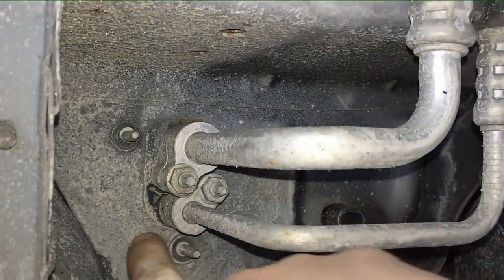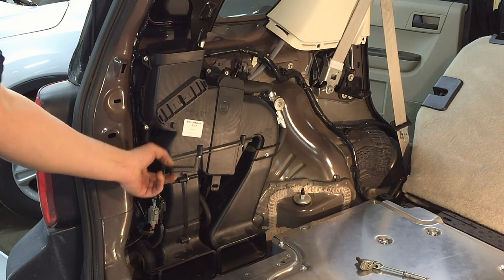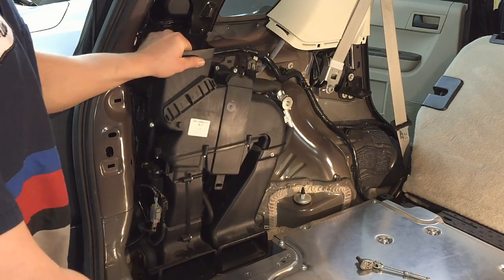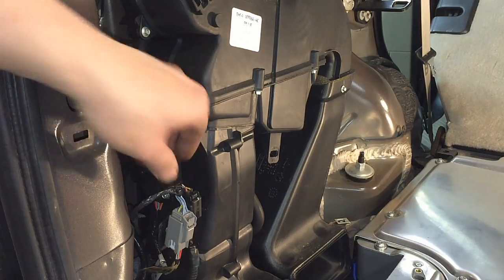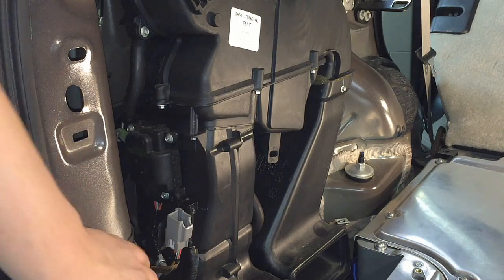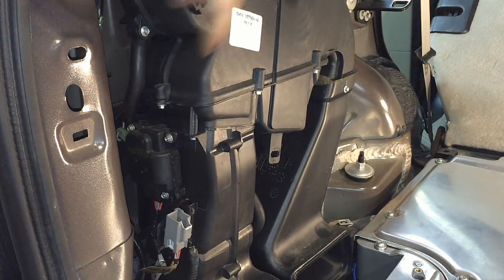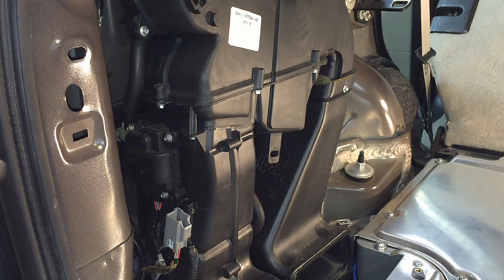Once the box is free from the body, manhandle the case up and out a little bit so we can get to the actuator and its bolts. Get the big bracket past the case, then use a pry bar to gently help the studs through the body with light pressure. Once it's loose enough, disconnect the connectors and get them out of the way. With the case up and out, we can access all three bolts on the actuator, which are 5.5mm. The reason we had to move the case is that the back bolt is too close to the body to reach otherwise.